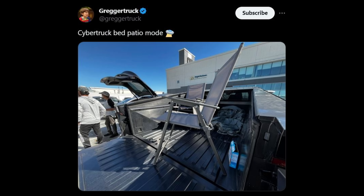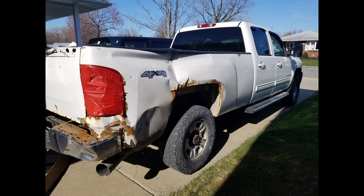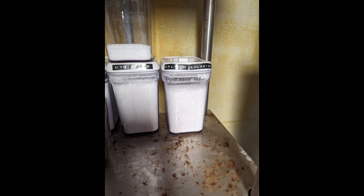Traditional paint cars rust all the time too. In Michigan, the roads are really salty, and if you get a bunch of salt in your car — especially if the paint is worn away — and you're not washing or rinsing it off a couple times during winter, that can really accelerate rust. Unfortunately, it's the same for stainless steel. If you have damage near the bottom where you're kicking off rocks and also kicking up salt, that can further enhance corrosion. If you have a wrap and then get all dinged up underneath, with no oxygen access it can start to spread.